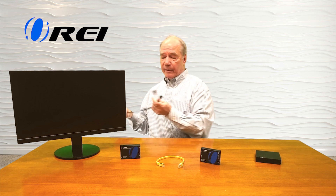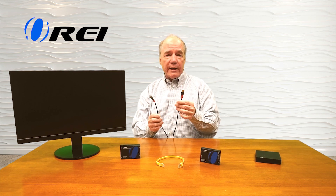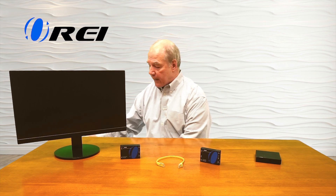Normally when you're connecting a media device to a monitor they're usually in the same room and pretty close to each other, so you can use a simple direct connection and an HDMI cable that looks like this. This is a one meter cable — they come in various lengths — one end goes to the media player, the other plugs into the monitor. The challenge is if you want to extend that distance, it gets a whole lot trickier because the HDMI standard was really not designed for long cable runs.